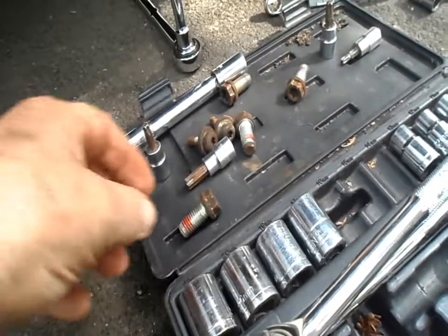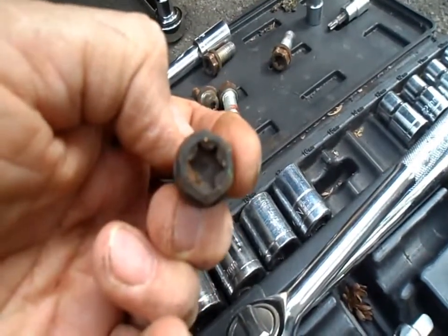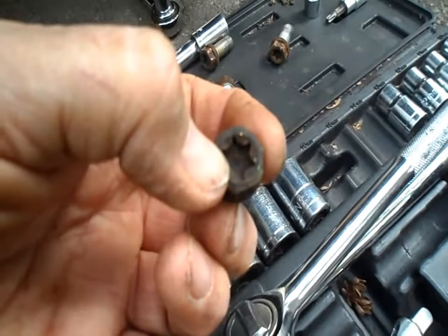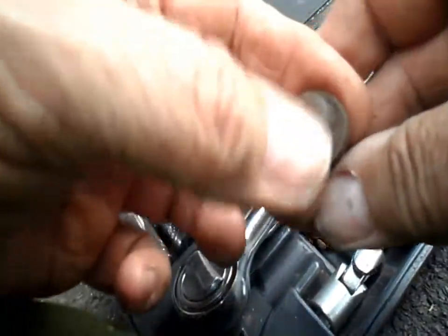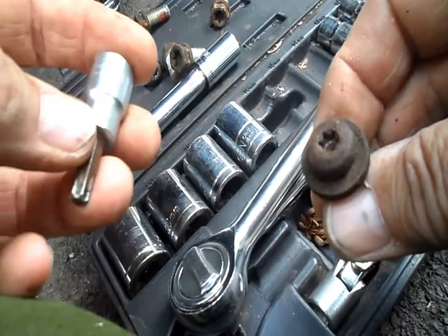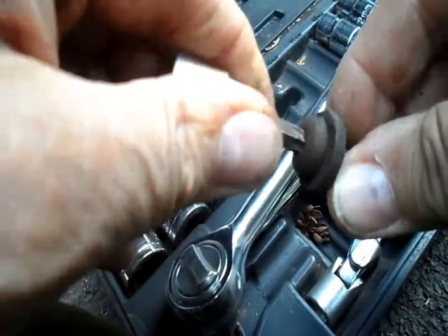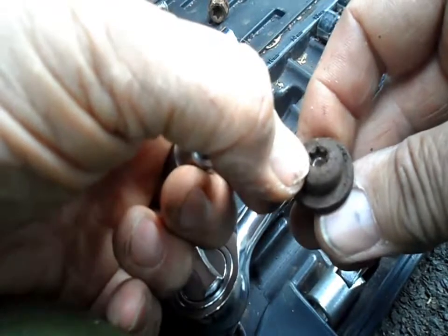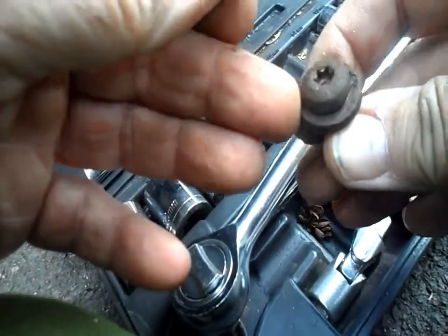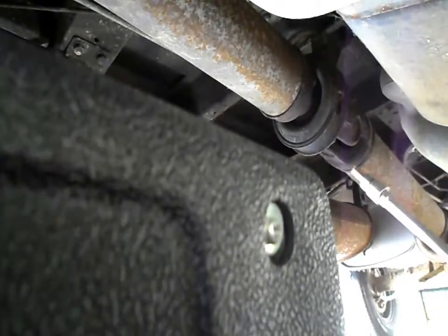Just a quick look at the bolts here. These are the bolts that fix the prop shaft to the diff and to the gearbox ends. They are a 16mm bolt head with a T50 Torx. These are the Torx bolts that hold the centre bearings on - there are two centre bearings - and that is a TX40. You really need to thoroughly clean out the socket before attempting to undo these, because if they are rusted or tight and you chew that, you're in a world of woe. TX40 again for the bearing carrier bolts.